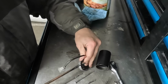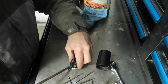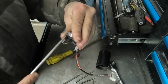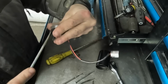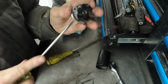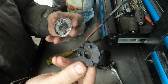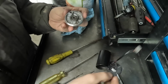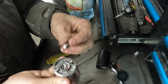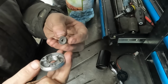All right, can we pry this brush holder off of here without removing my fingers as well? I'm sure there is a place where you're supposed to pry to pull this off. Actually, it's probably not ever supposed to come apart, but that's not going to stop us, is it? Okay, the brush holder assembly thingy is off, and now we can push this bearing out of here. It just falls right out. Interesting. There's no damper on this side, oddly enough.